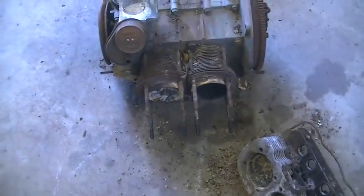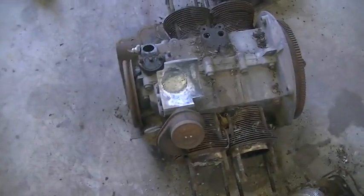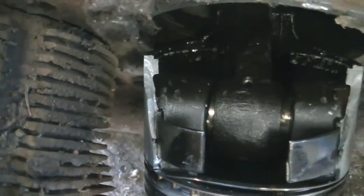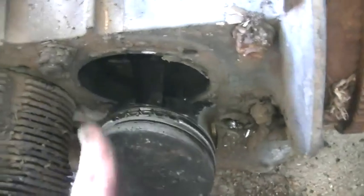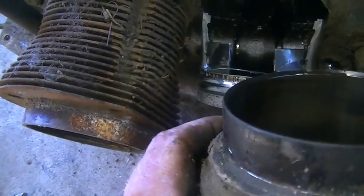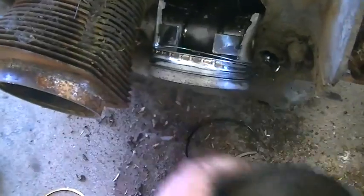But we do have one cylinder at least that is eligible. Going to rip the cylinders off now and have a good look at them. Problem B has also been discovered — this motor is not doing so well. We have one annihilated piston as well, and bits and pieces of ring everywhere. So far not so good for this motor. We've got one good piston over there but it has a broken ring. Of course one of these rings is not going to be salvageable because they are all in pieces. The barrels are very hard to get off — probably original, this one. But the barrel doesn't look to be damaged. I have to mic it up and have a look. But we do have one good barrel and one good piston so far.